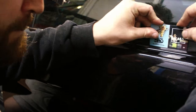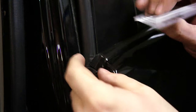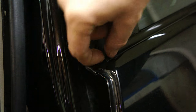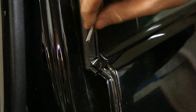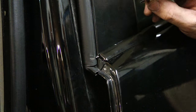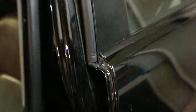Then you could go back over the top and stuff it in — it was a quicker operation. There are some details inside the door edges that aren't super critical to the look of the car, but when you open the door they take a little more finesse. You want to find where the edge is and a little crevice you can shove it into, then go back and use the razor blade to score that and pull it out so it looked a lot more finished when you open the door.